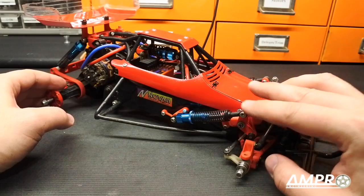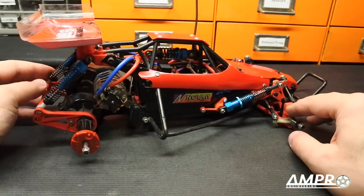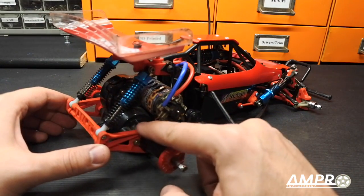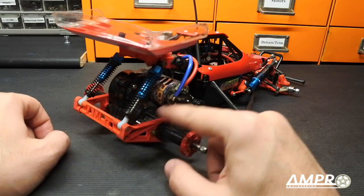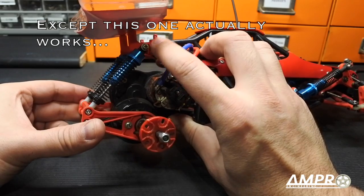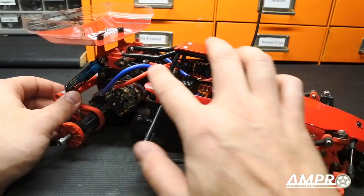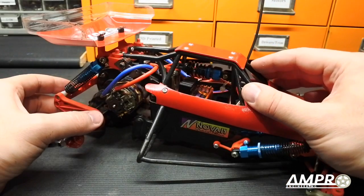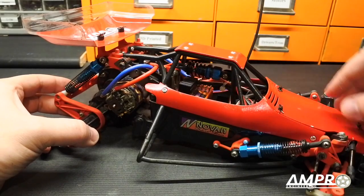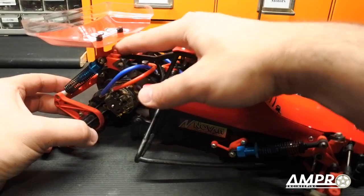You can see here that this has my cantilever front suspension. And at the rear, it has some other goodies here. This is a rear suspension mount, very similar to what the Super Hornet has. This is directly bolted to the Pro wing mount and chassis brace. And the way the whole setup works is there is a cage, which is also available from Shapeways, that integrates the entire chassis, every single mounting point on the chassis, to the rear wing mount.